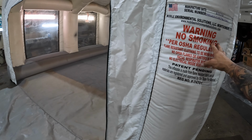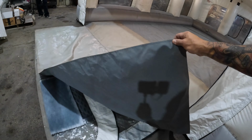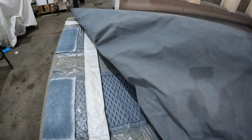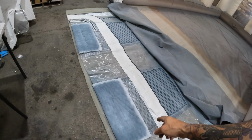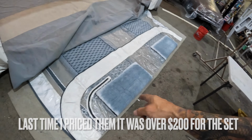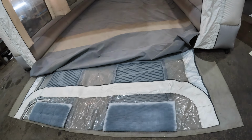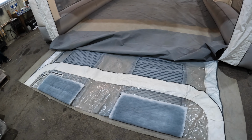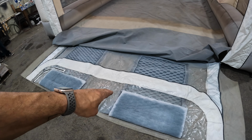So their shop is in Texas. Yep, Montgomery, Texas, if you want to look them up. So this is like a protective for your door. Okay, so your door is actually what has the filters, and there you really see the fjord blue. So their doors take paint pockets, and they charge an exorbitant amount of money for those. So what I did is I bought a roll of paint pockets, the same stuff they use in real booths, like brick and mortar booths, and I make my own. I buy the Velcro off of Amazon, and I literally glue and staple them together.